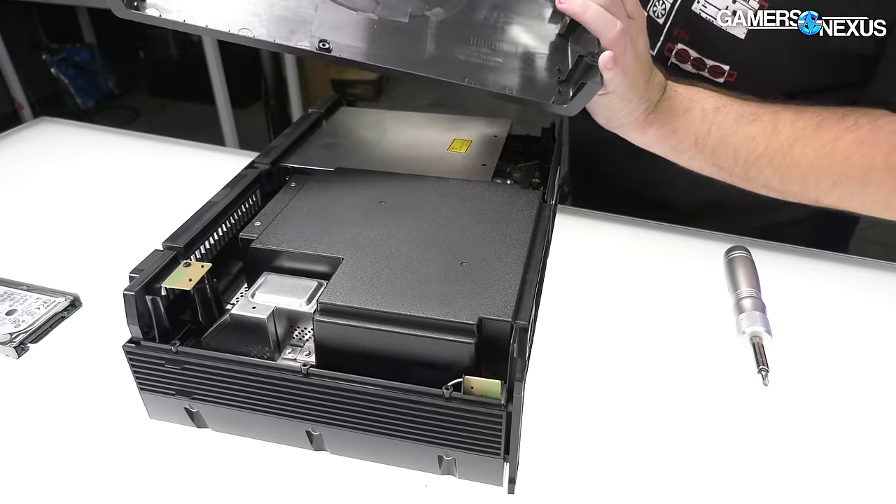Getting the top off was remarkably simple. On the inside of the plate there are manufacturer markings — this was made by Foxconn, who make most consumer products. Inside the first part of the interior, I'm seeing some shielding and the power supply as a module. There are two 40mm fans. The fans aren't as close to the front of the system as they could be — you lose some static pressure performance that way, but you gain potential flow benefit from spreading air over a wider area.